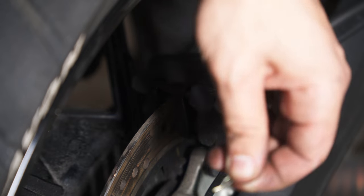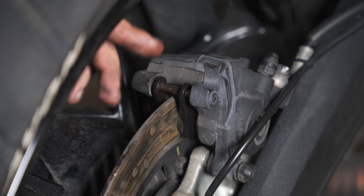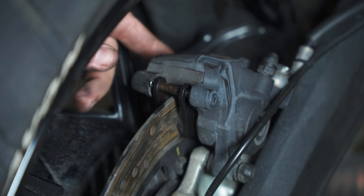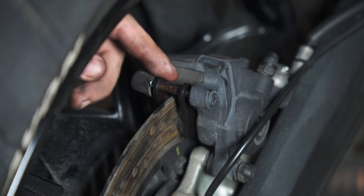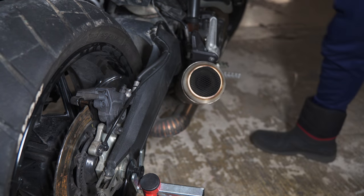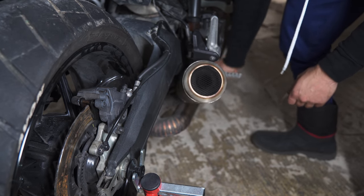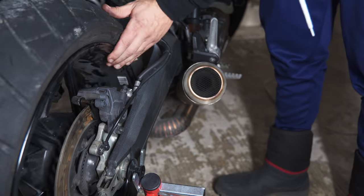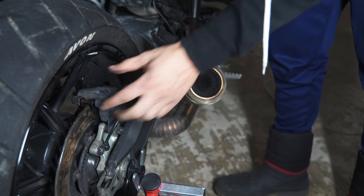Make sure to find your safety pin again — remember the hole I showed you earlier. We're going to clip it just like so. The pin is now in place and secure so it won't come out. Let's do again like we did on the front brake — pump the foot brake so the piston settles in. While pressing the rear brake the piston should go into place, and there is a slight drag on the wheel, which means the pads are now in place.